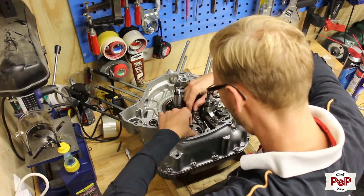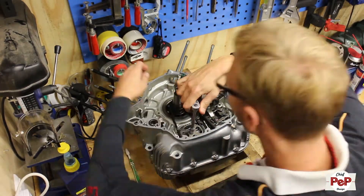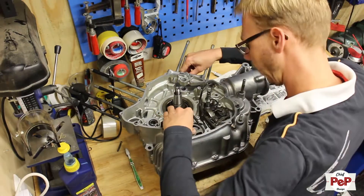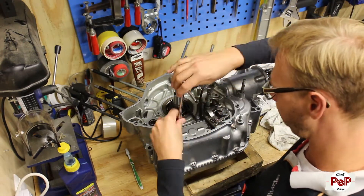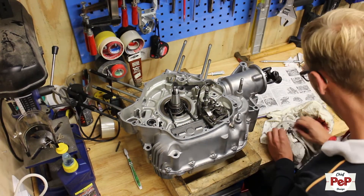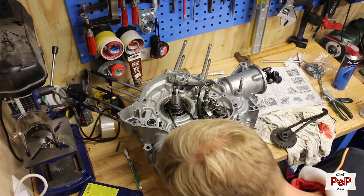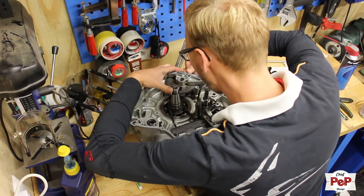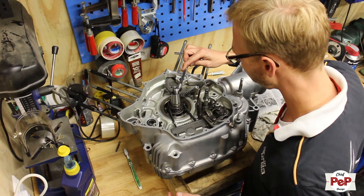The workshop manual mentions a cover including a tensioner, but from previous projects I noticed that not every engine has a tensioner on this cover. So probably the slack is just fine and the chain doesn't need a tensioner. This is the cover that has no tensioner. This is the gear with the camshaft chain — there is a left side and a right side, and the workshop manual tells you clearly which side goes where. It's really important that you time this gear together with your crankshaft.